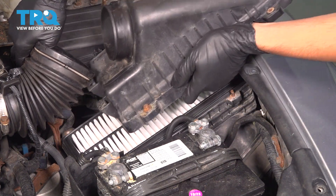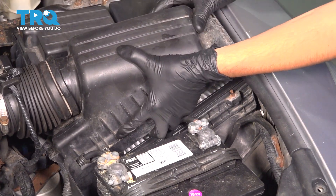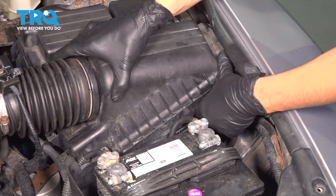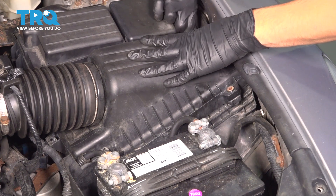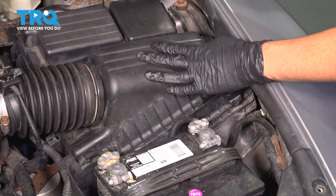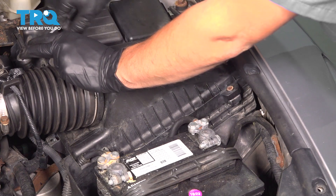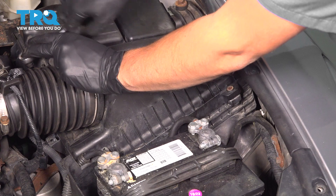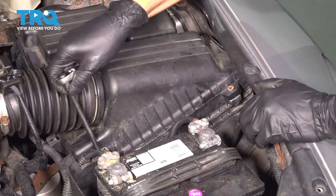Take the top of the air box and line it up. Sometimes it's easiest to install if you just push this back on and line it up on the bottom half, and of course line up all the screws. I'm going to try and start them in to make sure that they're actually lined up — looks like they're all starting, so that's good. When you tighten these up, don't go more than about an eighth of a turn after they bottom out. They're small and they're just threading into an insert held onto plastic, so you don't want to break them. That's bottomed out right there — give it a little extra, and that's it.